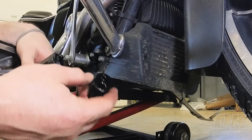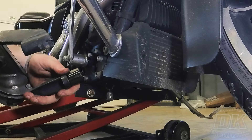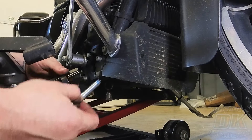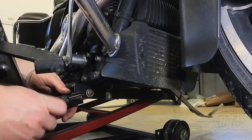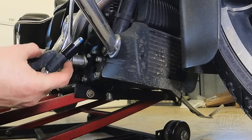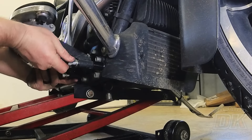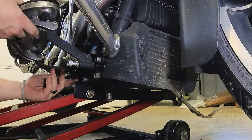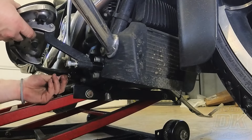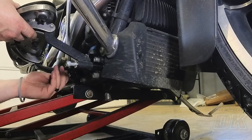As you can see, our machined parts are the same size and shape as the bracket. We have longer bolts and shorter bolts — the shorter bolts go on the rear, of course with thread locker on them, and the longer bolt goes on the front with thread locker as well. You want to get them started by hand. The rear has a dowel on it that needs to line up — once you get it lined up, your holes should line up and you're good to go.